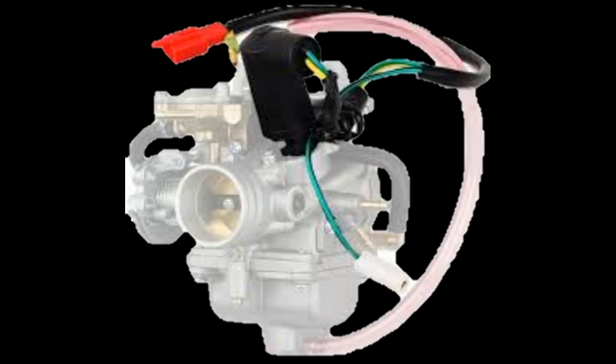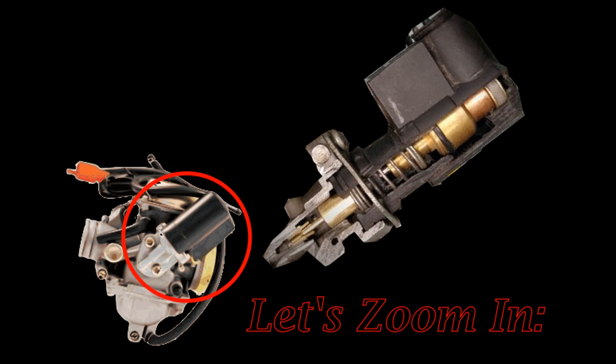The purpose of the auto choke is to change the air fuel mixture at engine startup. It does this by heating up a small wax pellet capsule with a heater coil when the initial engine startup voltage is applied. As this wax pellet heats up it expands, slowly pushing a plunger out at the opposite end. When the plunger is fully extended, this closes off the enrichment circuit of the carburetor, stopping the addition of extra fuel. So in reality the choke works the opposite of what you might think — instead of choking off airflow, it's actually adding more fuel to your carburetor to help you start up.